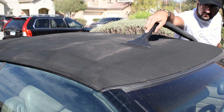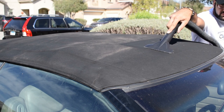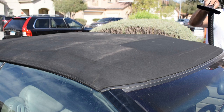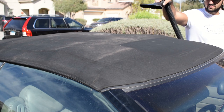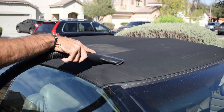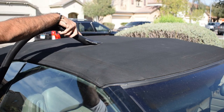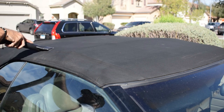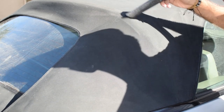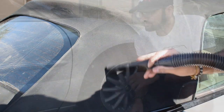So the first thing we're going to do is go ahead and vacuum out that convertible top. Now you can use pressurized air as well — that's an option too. I just find that a little bit more difficult with dust and debris flying everywhere throughout the air and getting back on the vehicle. When your convertible top is mistreated over time and not taken care of, it loses its hydrophobic ability and all that dust and grime gets stuck inside the fabric rather than being washed off. So I'm using my wide angle attachment on the vacuum and simply going over the convertible top, vacuuming out all that dust and debris stuck in the fabric. Just be gentle with it — don't put pressure, just let the suction take care of the dust. For the sides or smaller nooks and crannies, grab your other smaller attachments and use the general purpose crevice tool to take care of the rest of the convertible top.